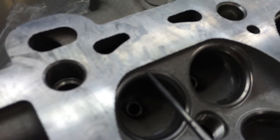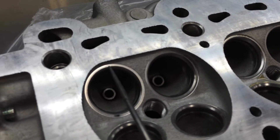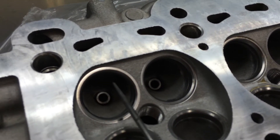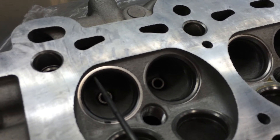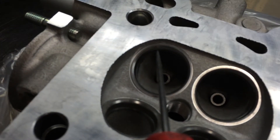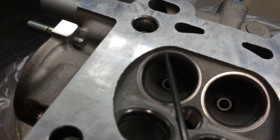There's the bottom of the cut — this surface right here. You can see that's the very bottom of the cut right there, and that meets the valve seat. This area in here is your valve seat, and that's steel — it's a steel insert pressed into the casting. There's your valve seat area; you can see right about there where the valve seat steps.